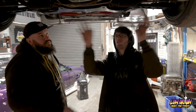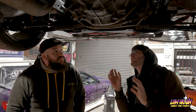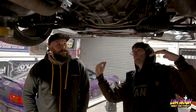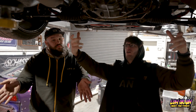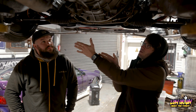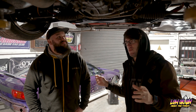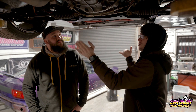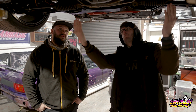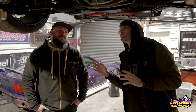This front subframe is a completely bespoke part from Dan Prior — Destroy and or Die. He's made this completely from scratch, designed to do multiple things. First is to move the steering rack further forwards, which is supposed to stop the rack arms from going over centre — which is where you see in any old drifting with very little steering mods, the wheels sometimes do this on full lock. So that's the bit where it's been pushed forwards — and it's 40mm forward.